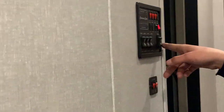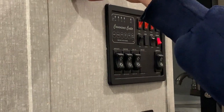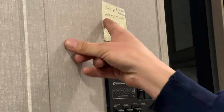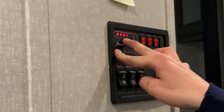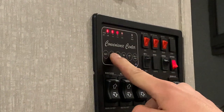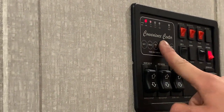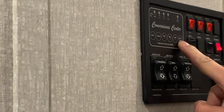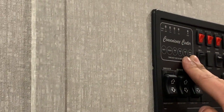You do have this light switch right on the wall here — this does just turn on the entry lights. Then you have your monitor panel system, which the technician was nice enough to label which each tank is filled from. You've got your battery which goes low at 11.2, 11.7, and 12.3 volts. Your fresh tank goes empty, one third, two thirds, and then full. Black one is monitored; black two isn't hooked up to anything because you don't have a second black tank. Gray one is filled from your bathroom sink and shower, and gray two/auxiliary is filled from your kitchen sink.